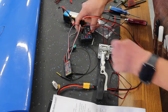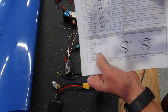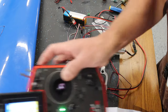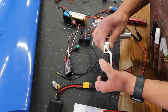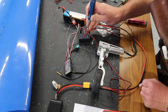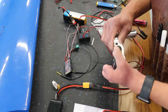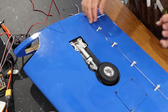The brake system is hooked up — fairly straightforward. There is an ABS setting on this controller: dip switch number three turns your ABS on or off. Right now I've got our brake set on this slider, which is normal for me. With ABS on at halfway it kind of just pulses; at max it's a little bit stronger. If we take that dip switch and go ABS off, the brakes are basically just on or off. I think we're going to leave the ABS on — it's basically pulsing, which is a nice feature.